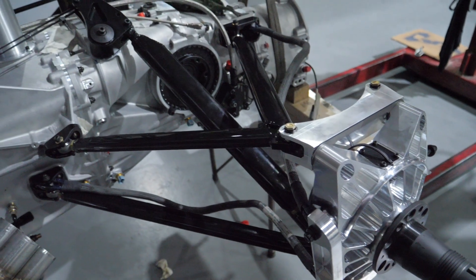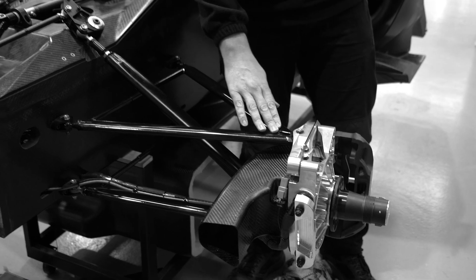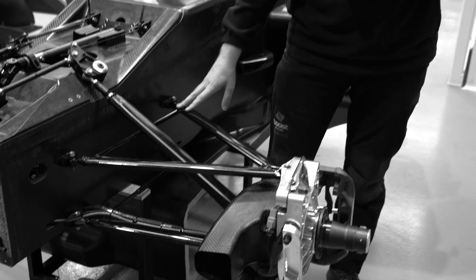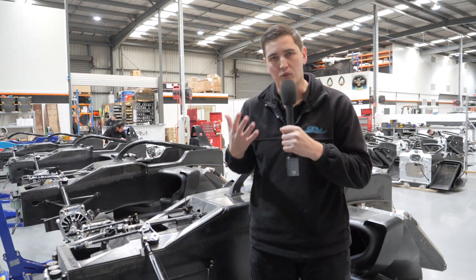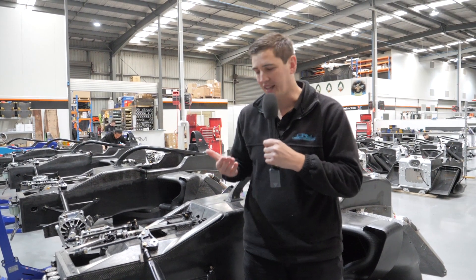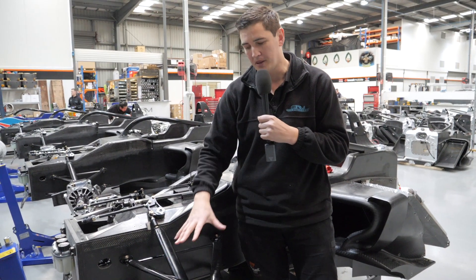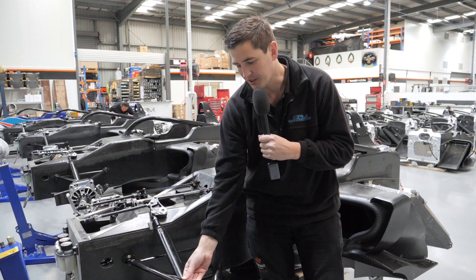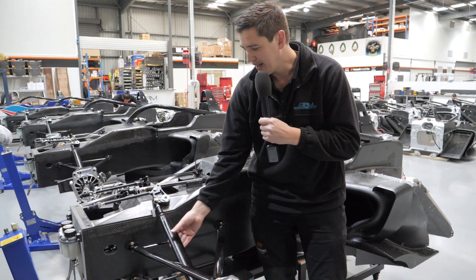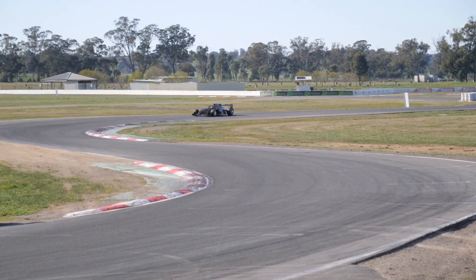So you can see here, it's all made of an aero tube material. This is all chromoly steel with chromoly inserts, all welded together. It's got to take the loads of the wheel getting slammed by the bumps and the aerodynamic loading of the wings and the body of the car. It's got to transfer that through to the shock absorber and give the driver a good feel — it can't flex. So they've got to be very stiff, and we make sure that the air flow leaving it is as undisturbed as possible.